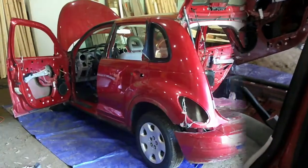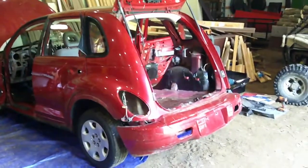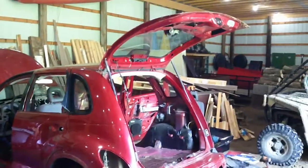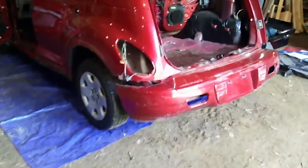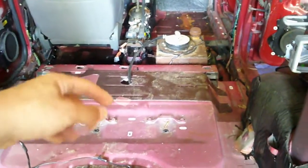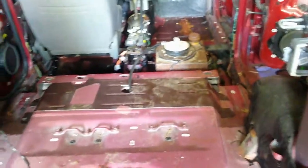Just a quick update — we have got the rear hatch open. It was locked shut and couldn't open from the outside. I was able to get the plastic off on the inside and manually pull the lever down and it released. Got all the wires going into the window, lock, and everything out, so I'll easily get the back bumper cover off. Got all the door windows out including the door panels. The inside is pretty much stripped. That is where we're going to run the fuel line — I'm going to run my rubber hose around there and clamp it down.